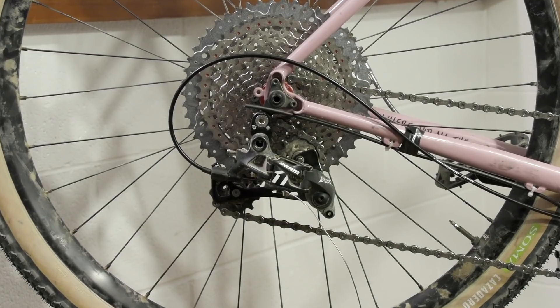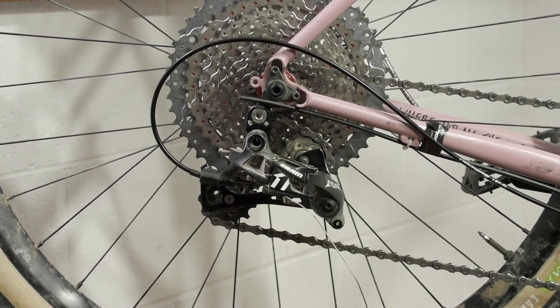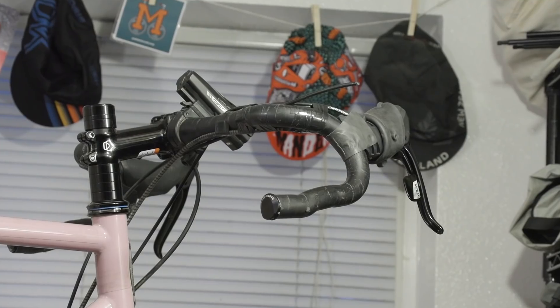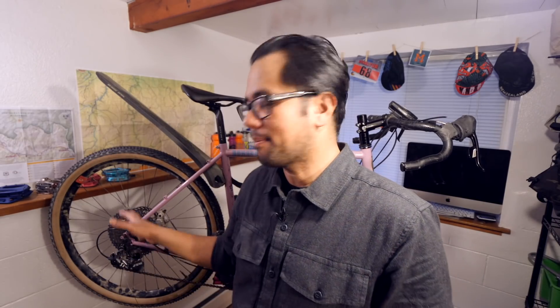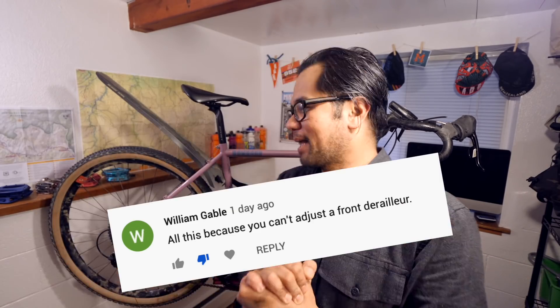What we're trying today is an Apex 1 rear derailleur that I harvested from my sad Salsa Cutthroat sitting in the corner completely derailleur-less, and we're going to see if it works with the Rival shifter. A lot of people have suggested this works, and some have said they were able to shift an 11-50 without adding the road link. I've found that not to be the case with my derailleur. And I know I can hear you guys typing away already — why not just get Shimano, get the Tanpan, blah blah blah. Well, I don't have any of those things, so I'm using what I have. And someone else is writing: why don't you just get a wide-range double — do you not know how to adjust a front derailleur? My response is yes, I do know how, but this build with the Bamboora was meant to be a budget 1x.